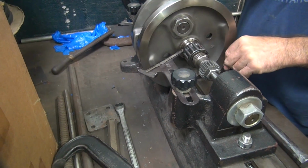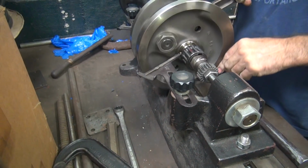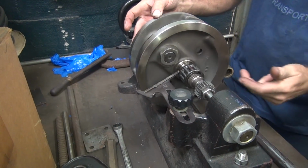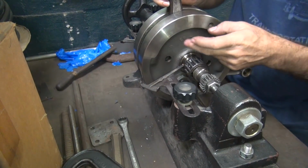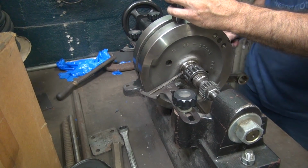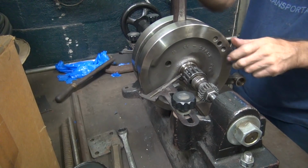Okay, so it appears to be high over here, and that one appears to be high over there, which is pretty close to equal, isn't it? So you go 180 over, which is just past center, and you stick this thing in there. Center's there, just past center. Loosen up the crank a little bit, and you give it a little love tap. Did that move any? Yeah, moved.